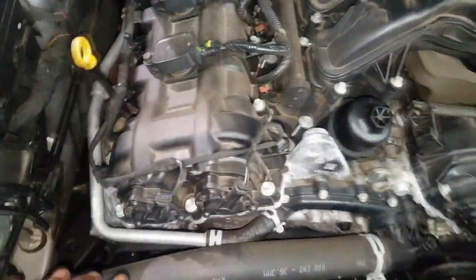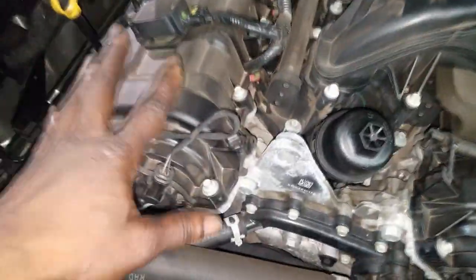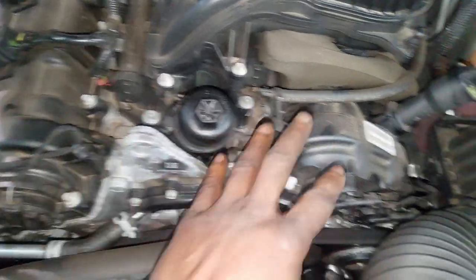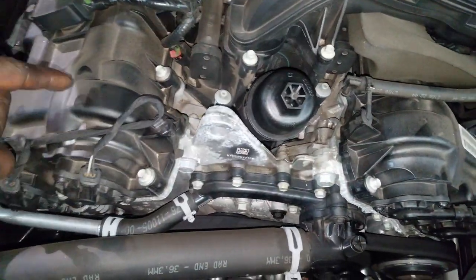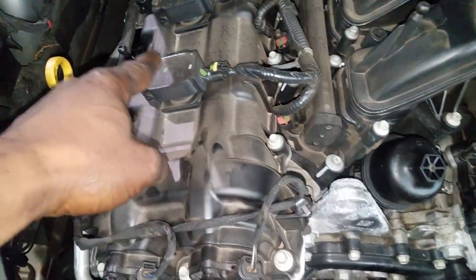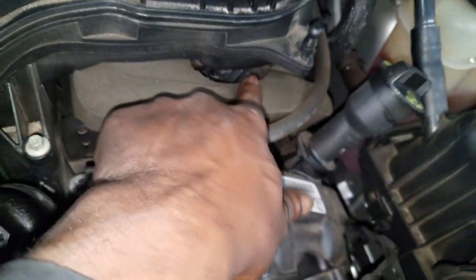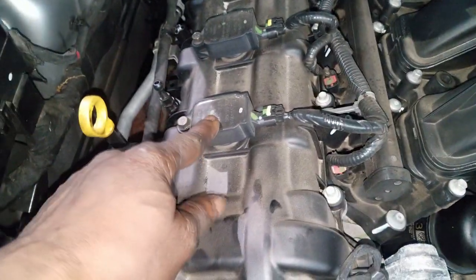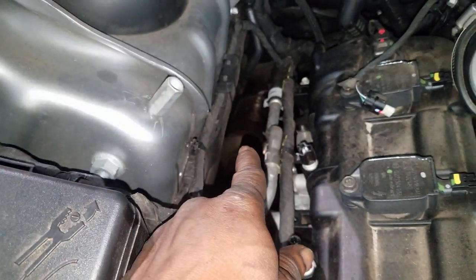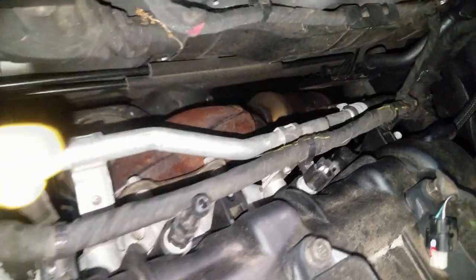I've got the cover off now. Let's take a look at this engine — this 3.6 engine can be installed sideways or in different orientations. What we want to look for is the cylinder head that's closest to the front. You eyeball it. We're trying to determine where cylinder one is — that's how you determine where bank one is. Bank one is basically wherever cylinder one is. In this case it's on this side, closest to the front.